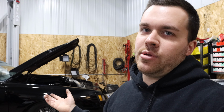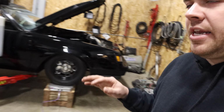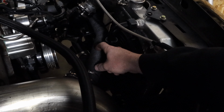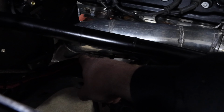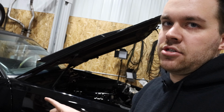Oh. And then last night we started looking at things that we want to address aside from the air to water intercooler installation. And we saw that the exhaust is kind of, and they did a really good job with all the stainless and getting everything. I wish that these had some slip joints on them because the wastegates are plumbed back into the exhaust. So it'd be preferred to have a slip joint on them so they can kind of expand and contract. But otherwise, the aluminum was sitting on the frame rail, which it's pretty close still. But it was sitting on the frame rail, and then the muffler itself was tucked up against the floor. So it was hitting the floor, the frame rail, and then the actual exit of the exhaust muffler was right on, or into, the transmission crossmember. So I'll show you that.